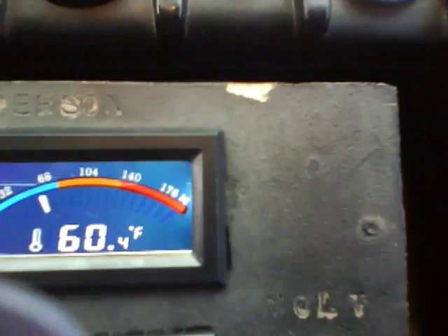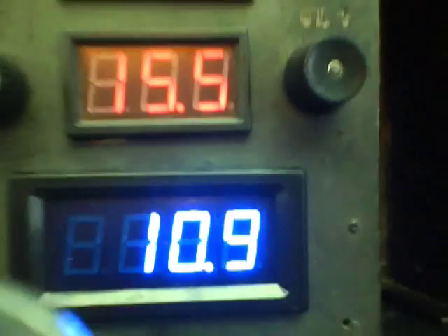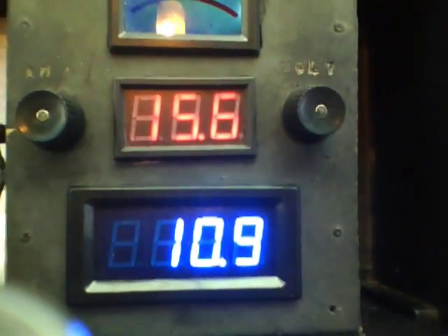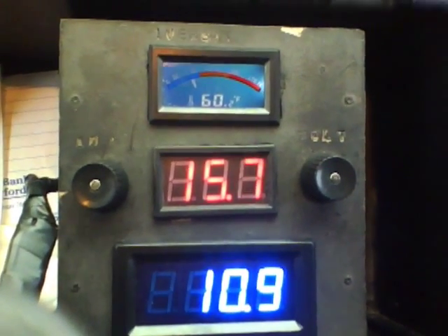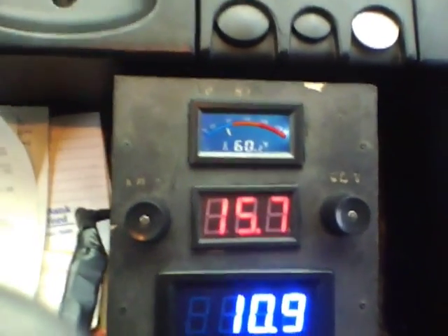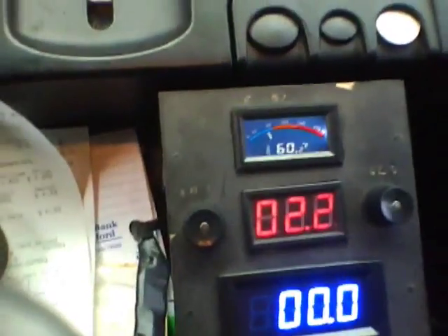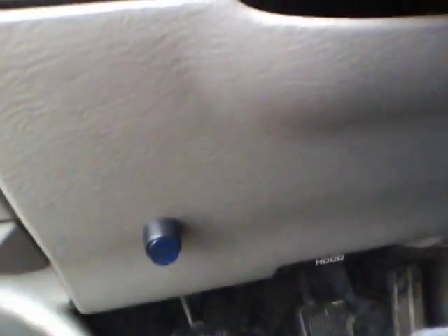It's still cold, just warming up, so it's only pulling — let's see what it's pulling. 60 degrees, it'll warm up. The amperage will start building up as it gets warm too, to around 20 is what I have figured for right now. I'm gonna shut it off. See, it goes off because I have it wired to when you turn the key — the switch goes out. So I'll turn that switch so next time I turn the key on it won't come on.